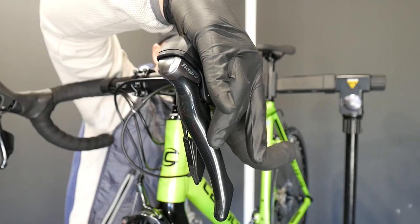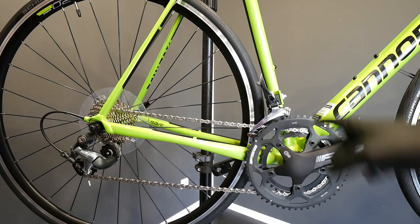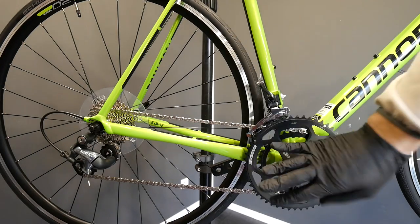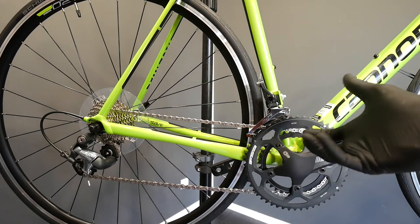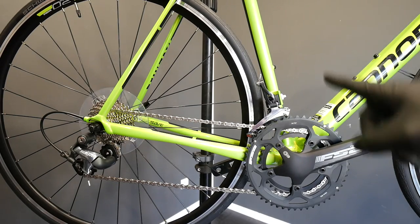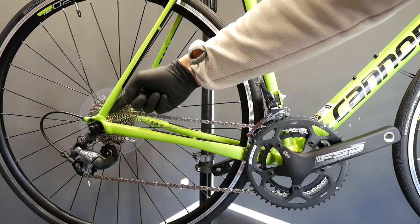This is trimming, this is changing the gear. Most road bikes will have two derailleurs: a front derailleur and a rear derailleur. I do really recommend having a front derailleur on a road bike — I wouldn't be happy with a 1x12 or even a 1x13. The front crankset has two chainrings; some cranksets on more budget or beginner bikes will even have a triple crankset, which is great for long distance trips in the mountains. The problem is when we use the big ring at the front and try to use as many gears as possible on the cassette.